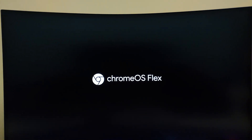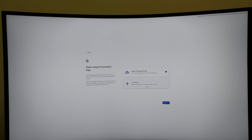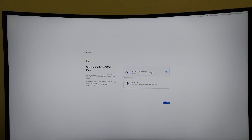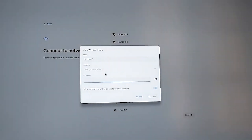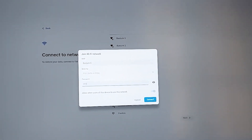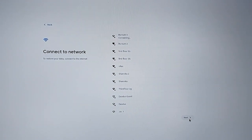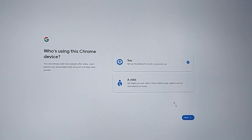You will automatically boot into the Chrome OS setup screen. It'll say 'Welcome to Chrome OS Flex'. Click Get Started. Now, this video is about how to dual boot — if you want to install Chrome OS Flex, you need to install it on a separate hard drive or SSD. If you want to do that, click 'Install Chrome OS Flex'. I'll be doing 'Try it first', which can also be used as dual booting. Click Next, Next, connect to internet, accept and continue, click Next.